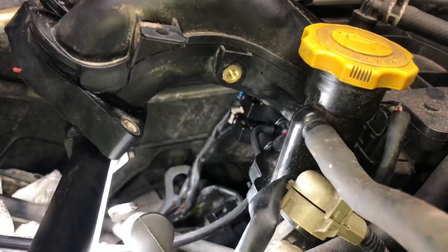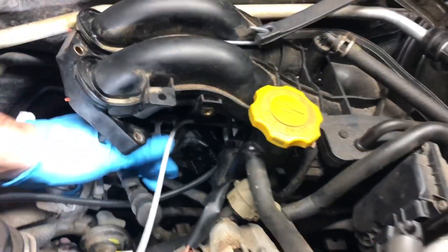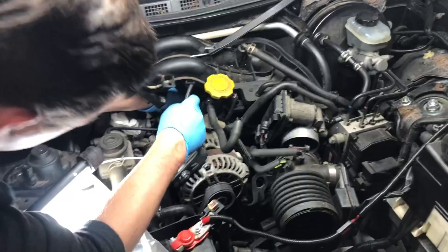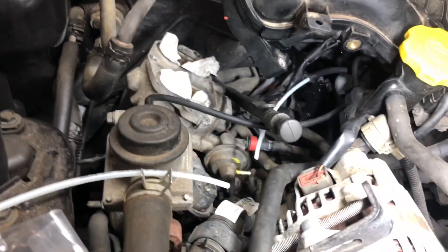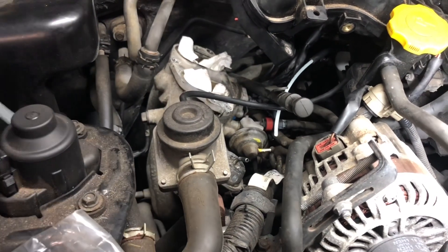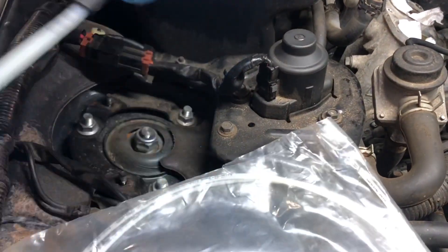Okay, put that in there. Here are two more — this thing's harder to rock, but they're done. Now we need to run the other line and put the rubber grommet. Apparently there's a Porsche upgrade with lines that don't break — they don't get hot and they don't fail. We're going to cut another one — just the yellow one, the shorter one goes in the center. I'll use the long one so they can't disconnect.